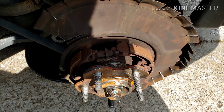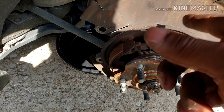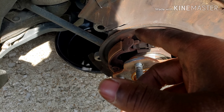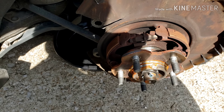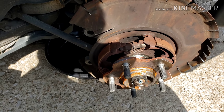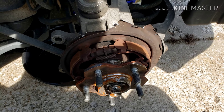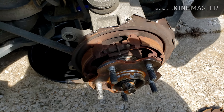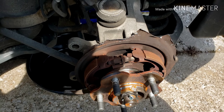I think it's a little easier when you make these little cuts like I did on the dust shield — didn't bend it back, just started cutting. On the other side I tried using a cutting disc and it works fine, but that's a little messy. As long as you have a good set of tin snips you should be good to go. Here is my first round of cutting with the scissors.